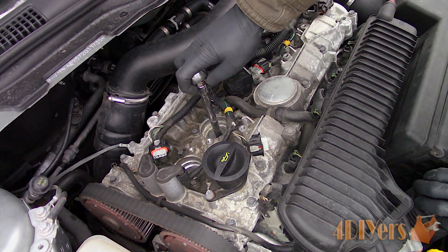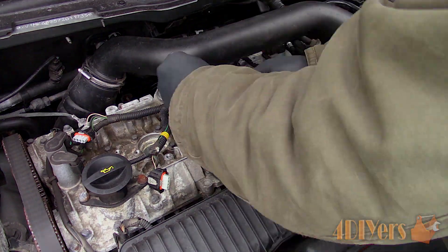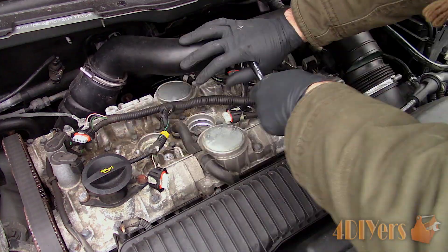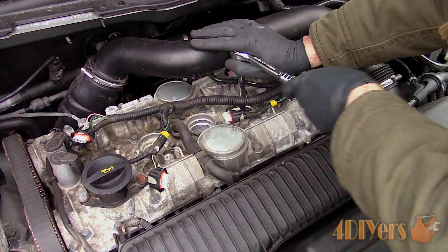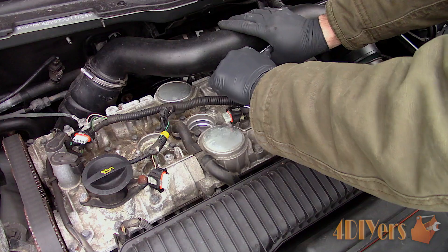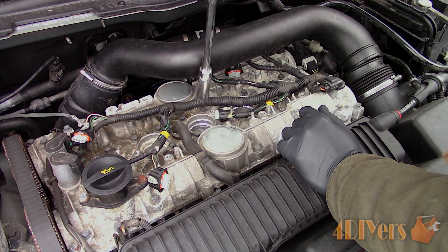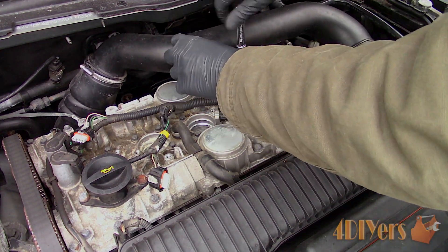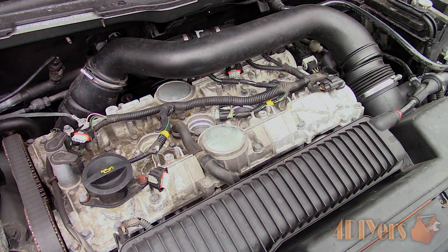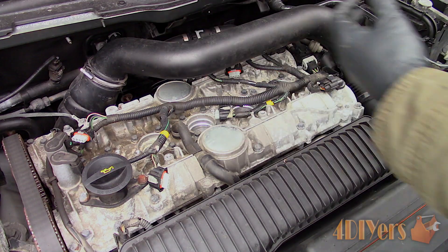Install the spark plugs and snug them down. Continue to remove the three remaining coil packs — again, twist and pull upward to break them loose. I'm still running into issues with seized plugs; these were actually worse. Taking my time not to force the plugs — loosening and tightening to help break them free. Patience is definitely key here. Install the remaining three spark plugs in place and snug. It's important to start the spark plugs by hand to ensure they are threaded correctly and we don't risk cross-threading them. Use the same deep socket with a 6 inch extension and 3/8 drive ratchet for all five spark plugs.